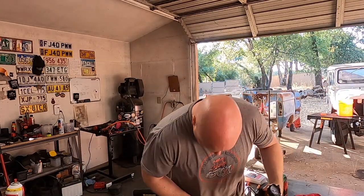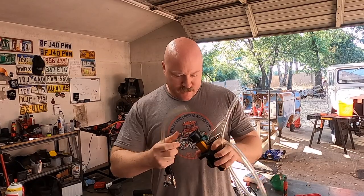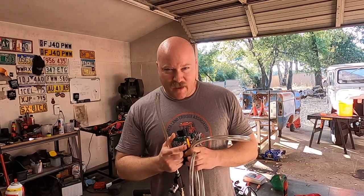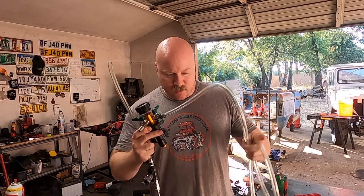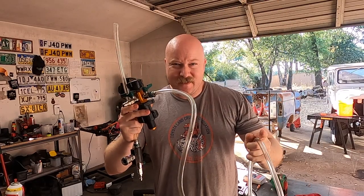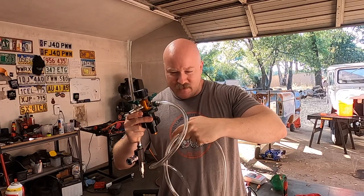I'm not gonna do the burping of coolant anymore. I went out and bought a specialized tool — this device comes from OEM Tools. If I hook this up to my coolant system I can create a vacuum. As long as the vacuum holds for about 20 seconds, I know the coolant system's in good condition. I'll dip this into coolant and use the vacuum to fill up my coolant system. This is the last step before doing the startup wizard and timing of the new engine.